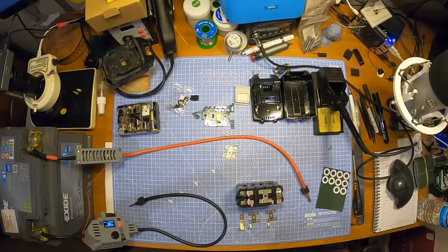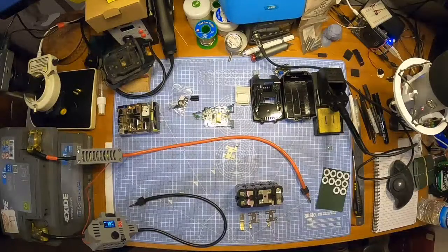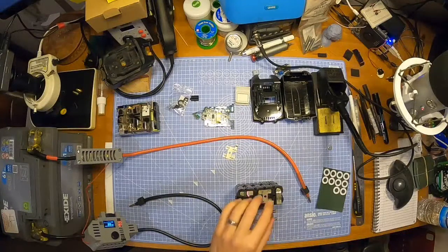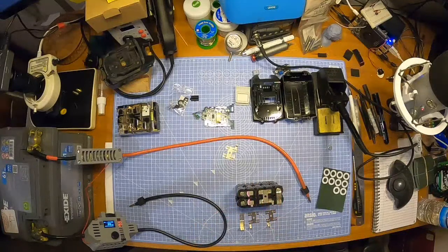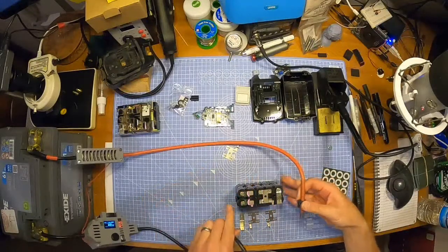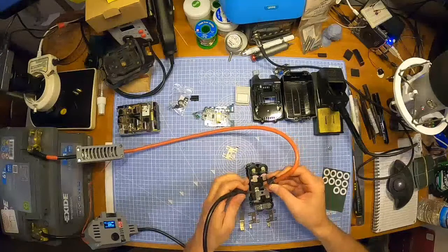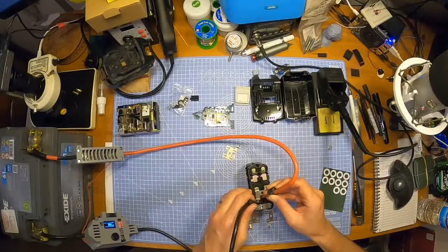So I've bought a Jumbo Shark pack which holds 91 cells, which is I'm doing a 48 volt 7p. So it'll be 13S7P with Samsung 35Es, and I think it works out to like a 24.5 amp hour pack. And I ran the numbers for someone in the forum the other day, actually, because they were asking recommendations for a pack, and I went with that one.